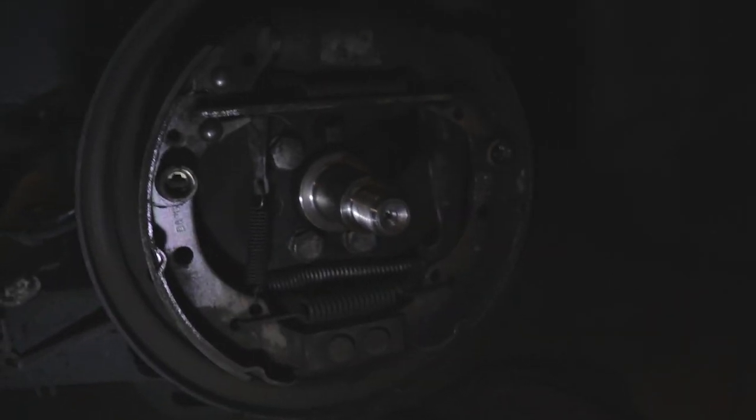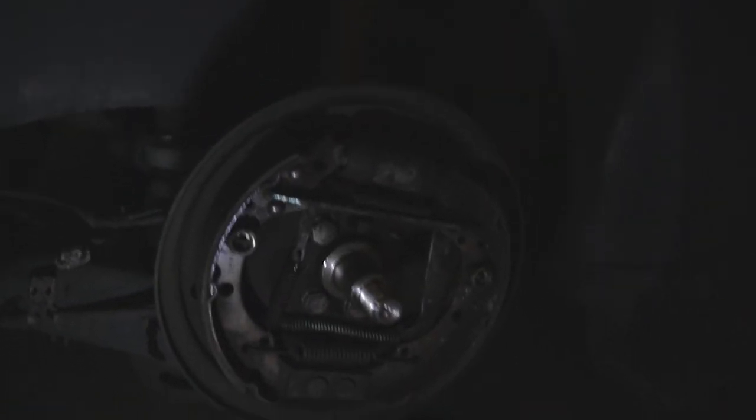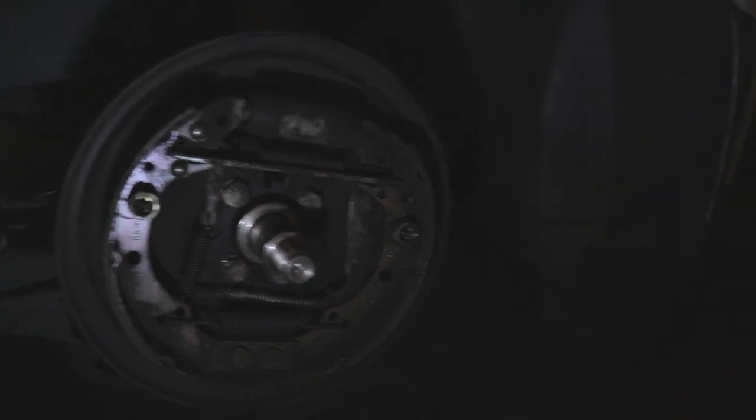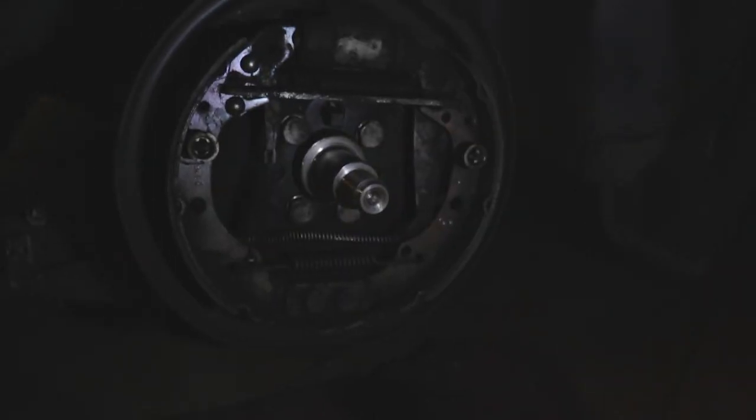And we did test clearance, everything's okay. The only thing we are dealing with is the bumper up here is flaring a little bit when we air the car out. But I'll show you guys that now, and once we tighten everything. We also had to shorten one of the bolts because the plate is hitting the original hub bolt. The bolt is hitting that, so we just trimmed off, what, like 2 or 3 mils? Yeah, about 2 threads off the bolt itself to fit. You only have to do the one, thankfully, but it wasn't too much of an issue to do that.